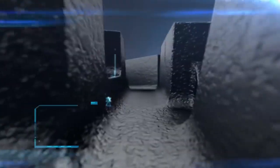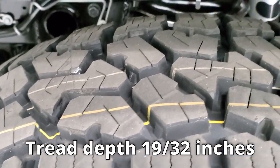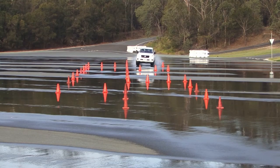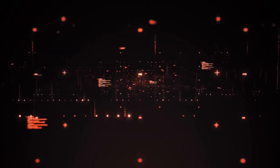The Wildpeak also offers the deepest tread in the category, going up to 19/32 inches, while the Duratrac offers up to 18/32 inches. With that greater volume, more water can evacuate, making the Falken Wildpeak more resistant to hydroplaning in comparison.